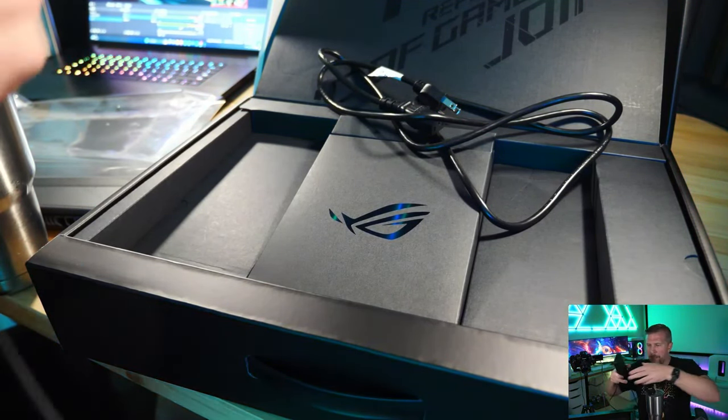And then we have two USB-Cs, and one of these is a Thunderbolt 4 with power delivery. Okay, actually both of them support power delivery, and they both are DisplayPort 1.4s, so you can do double displays out here. And one of these displays goes to the integrated GPU. I believe the Thunderbolt here goes to the integrated GPU, and this USB-C goes to the NVIDIA graphics card. The HDMI also goes to the NVIDIA graphics card.